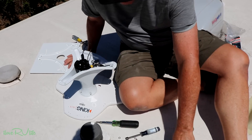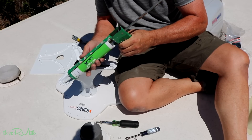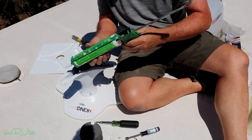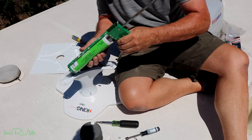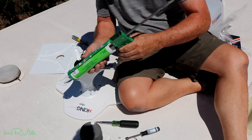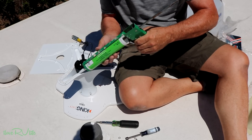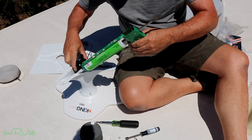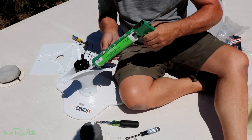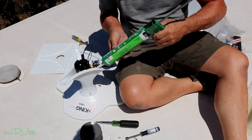The first thing it calls for is filling the base with lap sealant before we mount it. Now if this was a rubber roof I would be using something like Dicor. This is a PVC roof, so I'm going to be using something called EternaBond or X-Trim — this is specifically formulated for that. Whatever you do, do not use household latex caulks or something like Gorilla Glue. That will be a disaster. This is what they refer to as a self-leveling lap sealant, and that is what you want to use.